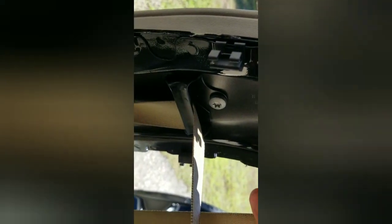The top is just falling out — it's got this little sleeve that slides up into the headliner there. Next we can work on getting this upper bolt out right here. You don't need to remove the slider; there's another bolt up there but you can leave that one in. Just remove the belt itself from the slider. And then down here we have the C — there's another one right in there. We'll pull this loose and we should be free.